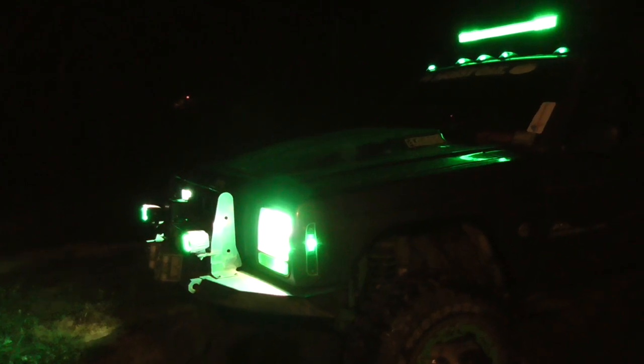But I'd never had death wobble at all when I first did this lift about 5 years ago. And then front end parts started slowly wearing out, and it didn't cause any problems. But then these ball joints went bad on this side, and it caused a crap ton of problems. And then I'm replacing all the bad parts, and while I'm in there upgrading some parts, and I still got it, so...